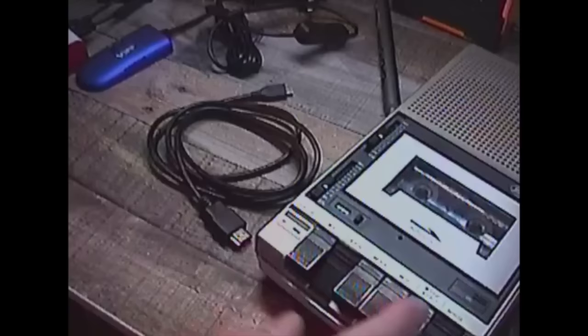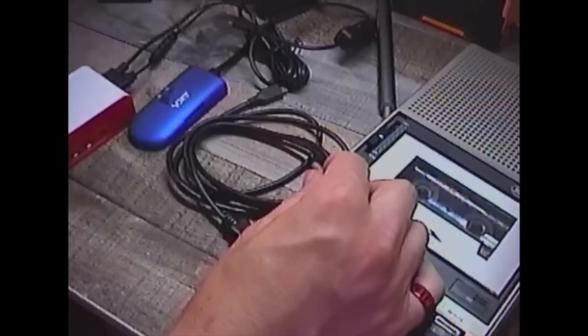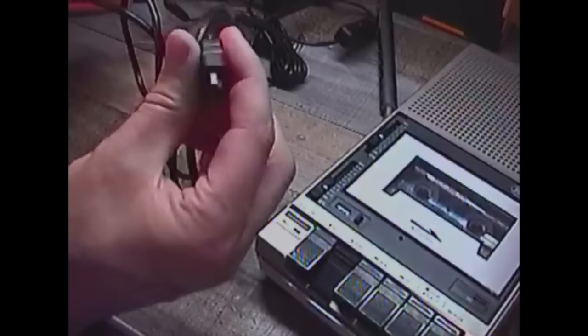And you might also be wondering, well, how do we connect it to the TV and get the picture in there? Of course, I showed you the little adapter that connects the Commodore 64 to the TV. So I'm going to use a similar method. But the only problem is the Raspberry Pi outputs as shown through HDMI, so I can plug these in here. That's now going to be the output of the picture. It's coming out HDMI. And obviously that's a 1980s TV, and that adapter isn't HDMI either.